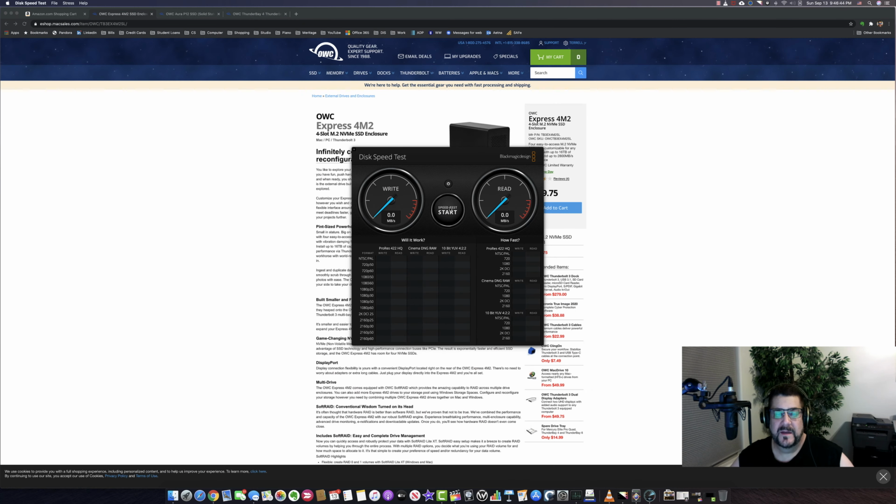Select the ThunderBay, and I was actually surprised at how fast, and this is also doing a very heavy read and write operation, so the numbers are gonna show a little lower than optimal. So we're looking at about 900 megabytes per second, almost a gigabyte per second on the write, 800 megabytes per second on the read. So 900 and 800, there it is. It went up to 912, and the read is impaired now because it's currently involved in a read operation, but that's pretty darn good for 32 terabytes of storage.